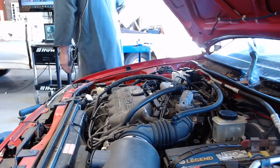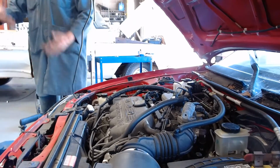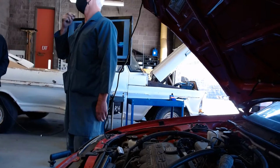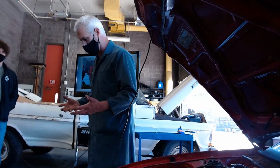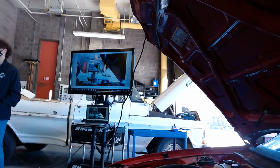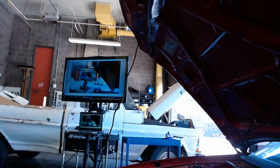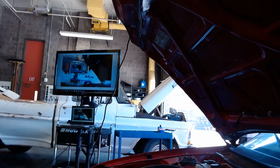Okay. So on this truck, it's really unsophisticated. It just has a carburetor and it has an ignition coil with a set of points that open and close. It's making spark, but the spark is terrifically weak, especially when it's not running right. It actually sparks intermittently. I think the resistor wire that goes from the ignition switch to the coil is defective. Just so I can show it to you. What do you think? It doesn't hold in there. You can see there's two holes in each one. Yeah, but this one's further out. Okay.